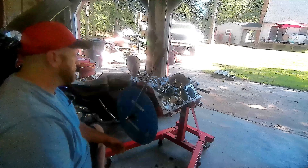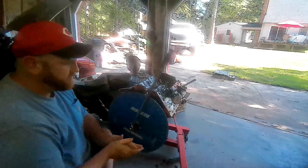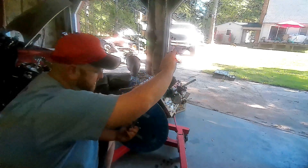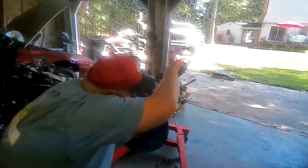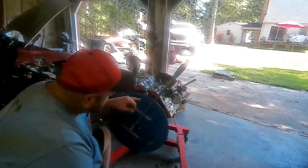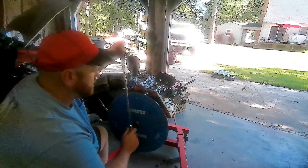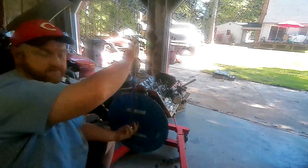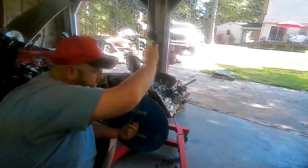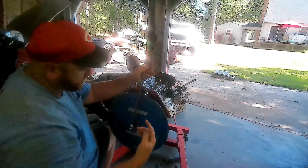I don't really have an extra set of hands so it's probably going to be just about impossible to show you this all the way. So anyway, we're going to spin it and this is going to come up to 50. We're at 11 and a half. Then we're going to go back the other way — we've got to go past the 50 and come back up to it. The reason for that is you have a timing chain in there and that's going to get some slack in it, so we want to make sure to go past it so we can roll the slack back the other way.